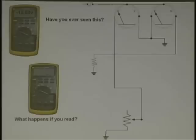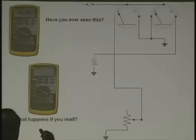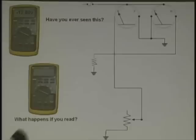What happened on this vehicle is that they did it out of the vehicle, then put the battery back in. When the battery was connected, there goes the alternator. There was no 175 amp fuse or whatever on this vehicle. They said something's wrong with the alternator, had it rebuilt, put it in, and did the same thing again. By the way, two alternators. That's why you always have to look and check stuff out.